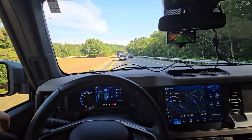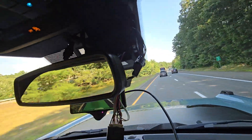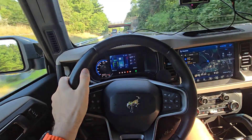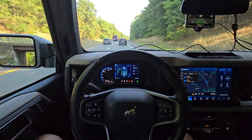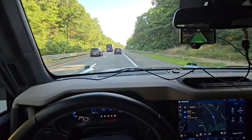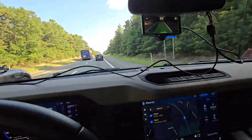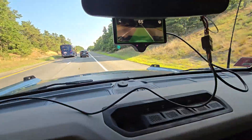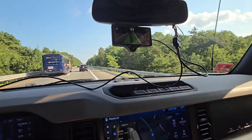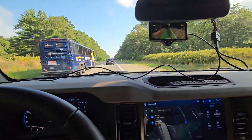It'll be interesting to see how this progresses. For anybody wondering, I bought the Ford Q3 harness — it plugs in at the back of the camera. The camera cover is super easy to get to, just a quick pry bar. I'm using an OpenPilot 3X, and I mounted it very high. I also had to buy two of the eight-degree mounts — one was not enough. What I did is I ground down the second one, made it flat, and stacked it on top of the first one to make it an even sharper degree angle.